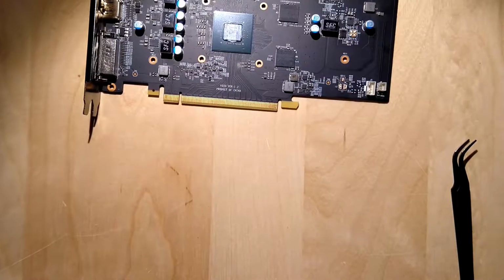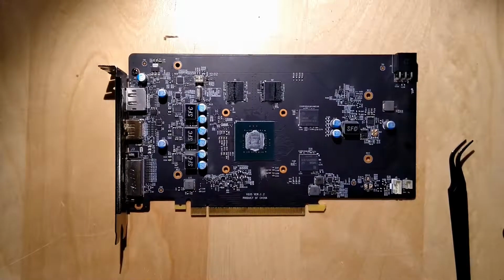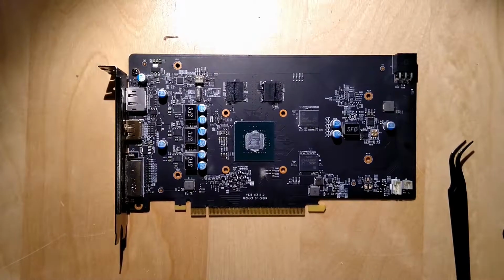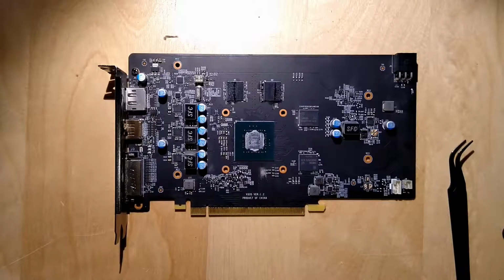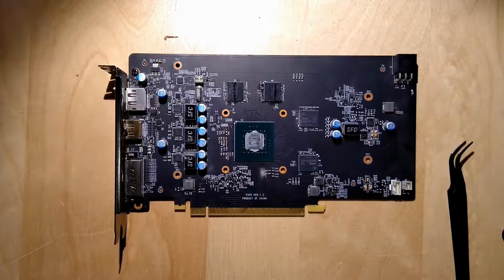So we'll take this one away for a short time and clean the little core. Yeah, now you can clean off that disgusting OEM thermal paste. That looks like it's probably rock hard. So after 3 years, that's how my 780 Ti looked when I first took it apart. So we will take again some cleaning petrol. Yeah, I think cleaning petrol is the right word. What it says on there, it says Reinigungsbenzin, which is German. So, yeah. No, that's enough. You don't have to take another one. A little bit is enough.